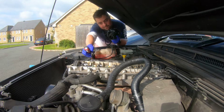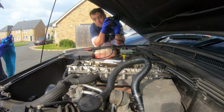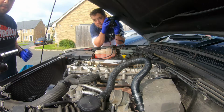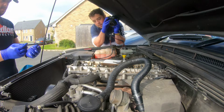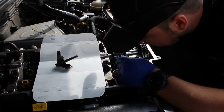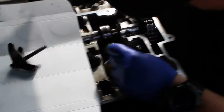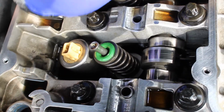What more do you need? Cardboard. I'll do one at a time and then we know where we are. Some people use eagle jaws or pipe grips. They take the bolt out of a small set, and then use half the handle to lever the injectors out. You get a small heel bar, a Snap-on, but not little. Then you can just about get underneath it, and just carefully, I don't want to damage the head. That's it, she's out. Pop goes the weasel.